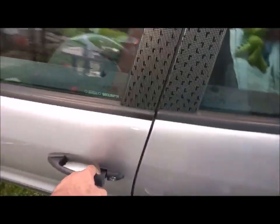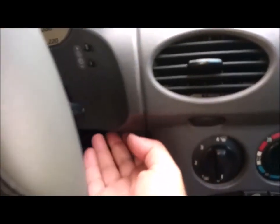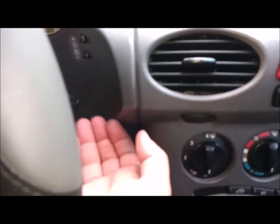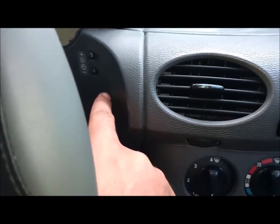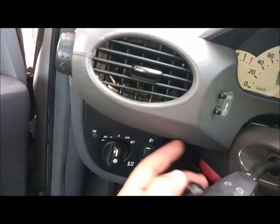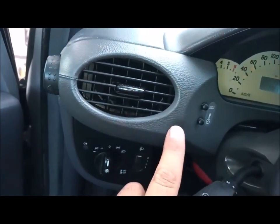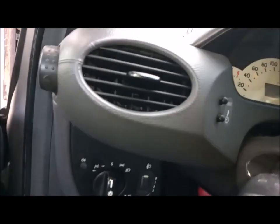I'm going to show you the details in the video. I want to go through the steps you really have to do before you start thinking the sensor is down. For the screws you have to remove, you have to take out this panel. There's a screw exactly here — one screw. You have to take this panel out from here as well, and you'll reach a screw here too. Those are the two hidden screws. Beside that, you have a screw here.